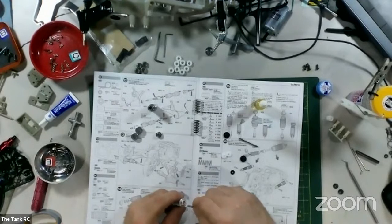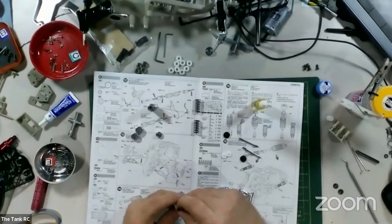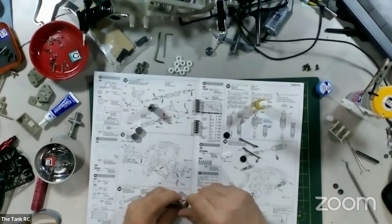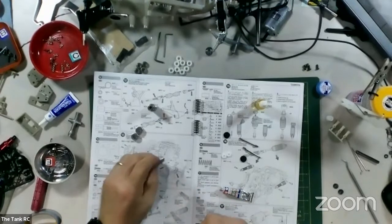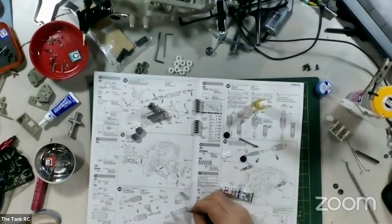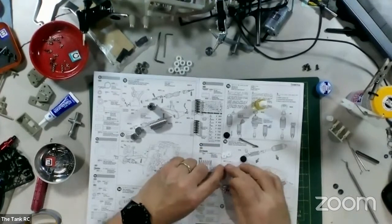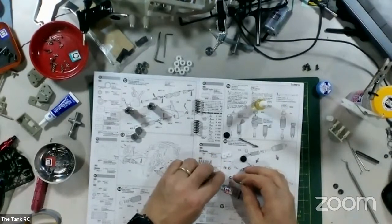You can't really make a great adjustment to that unless you dyno it too. They have dynos that do brushless and brushed. Without getting numbers, you don't know if you're improving the performance or lessening the performance out of it. Actually, I could tell by ear that it's spinning faster. It has a higher pitch than it did when it was on zero. Yes, but higher pitch doesn't mean anything. I could take one of my motors with the timing and twist it as high as I want to, and sure, it'll whine like anything, but I'll turn it right back down to nothing, and I can get more speed out of it.